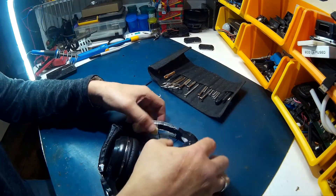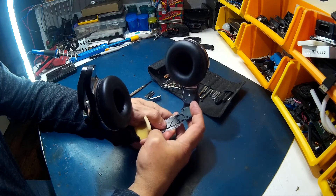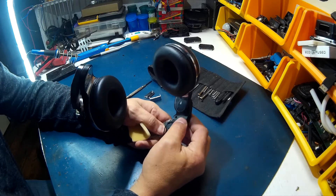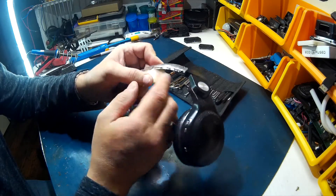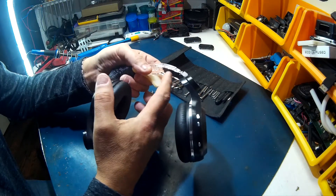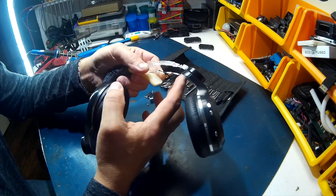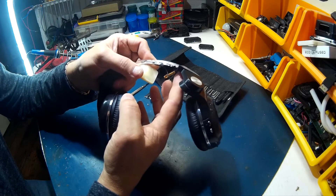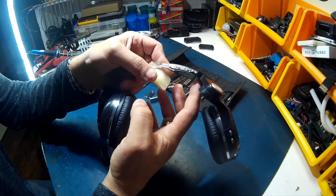I figured it out, guys — I'll quickly show you. This piece here just locks in there like that. When you bring it up, it comes out; when you bring it down, it locks in and holds everything in there pretty good. This is the weak area of the phones right there — because they put these little holes there for this to lock in, and it weakens the plastic. If this was solid plastic, you'd be fine. So just epoxy that all the way around and it won't do that anymore. There you go.